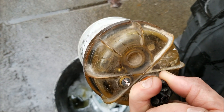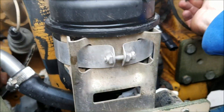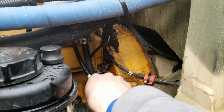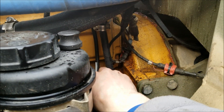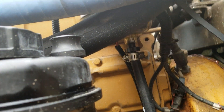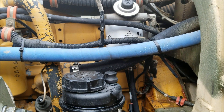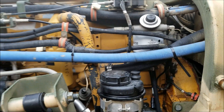So it's a good thing. I cut the heater plug off of there because the heater plug on the MRAP is different — mine has a spot to plug it in. It's been blocked off here because they're notorious for setting the vehicles on fire. But this has an updated one — it says 28 volt, 200 watt. So there's a 200-watt fuel pre-heater on this. It's only 25 bucks. I tried to buy just the bottom part, but that little bowl alone is like 50 bucks. So this is a good deal — good savings. It does thread on to the LMTV filter, so I was able to repurpose those parts for the LMTV. I got the couplings on too — they look a lot better. I'll hang on to the old ones as spares with the T-bolt clamps.